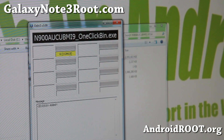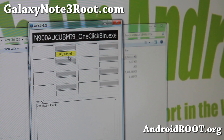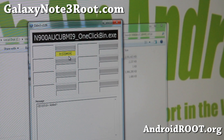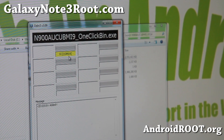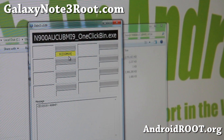But make sure you see this yellow highlighted box. If you don't see it, make sure you've installed Samsung USB drivers. If you did not install that, I have links on my website. Download the drivers in the step-by-step directions, install the drivers, try unplugging the USB cable, plug it back in and you should be able to see it. If you still don't see it, try rebooting your computer, or try a different USB port or a different USB cable. Sometimes that works too.